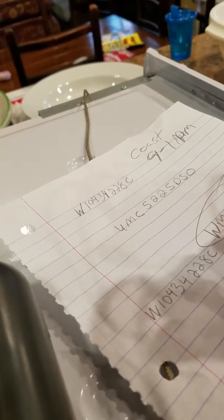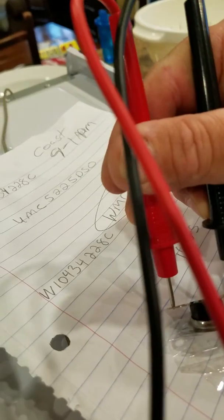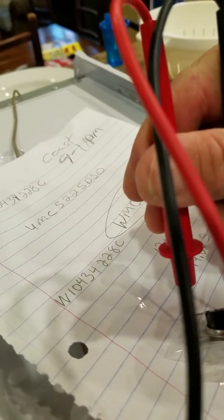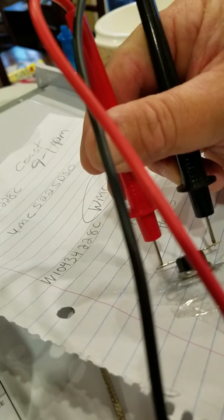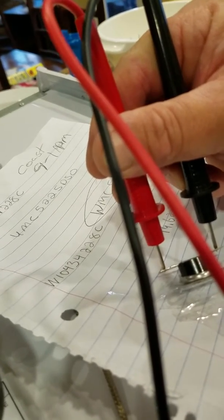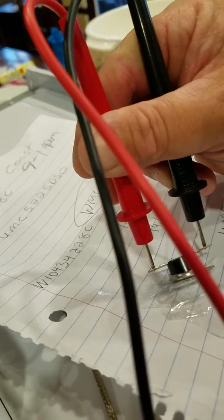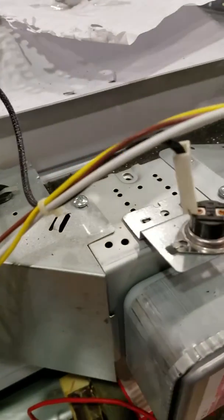You should get the tone if you have that type of resistance circuit tester that has the tone in it. This has no tone. As you can see, no tone. All right, and that means it's an open circuit. So that means that the limit, which is 120 degrees, has been surpassed by this microwave, and now has opened up this thermal fuse.